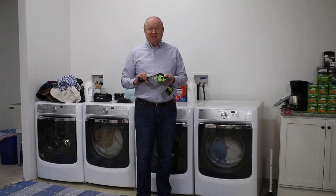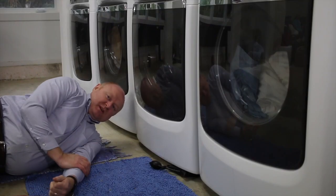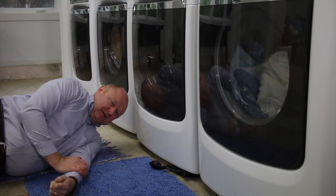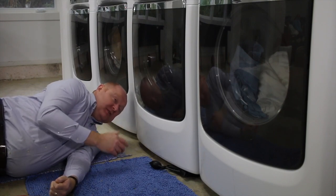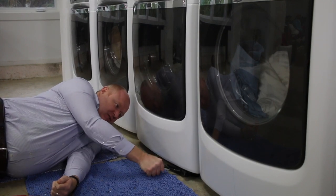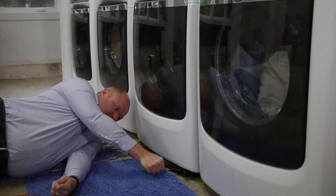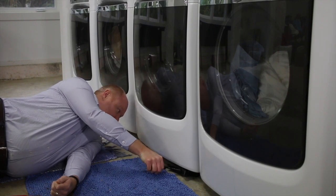So let's see how we can use it today. This air shim can handle up to 300 pounds — that's a heavy little item. So what I've done is I've set it underneath this washing machine, and then I can just take and pump it up a little bit, and then that acts as my third hand, and then I can get it to where I'm ready.